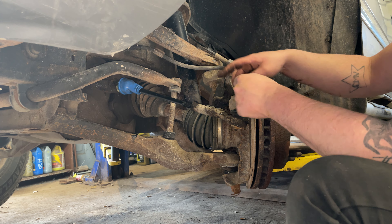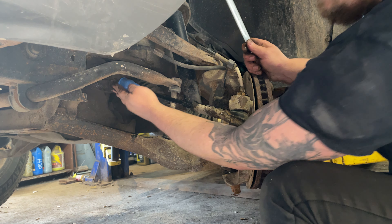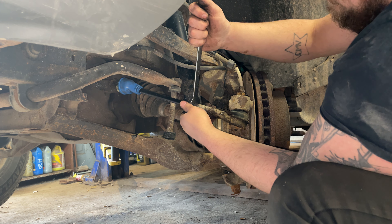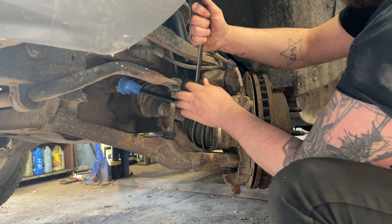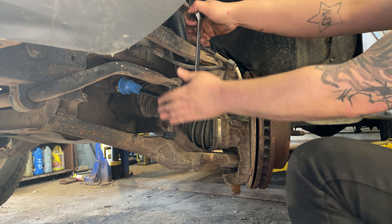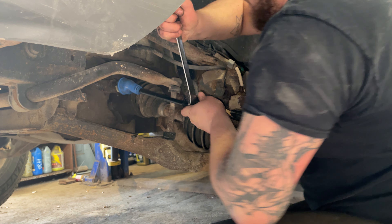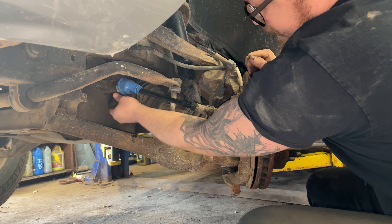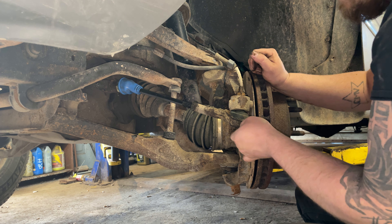This is tight. Now we've got to tighten up our retaining nut — that's going to be lefty-loosey to tighten this up because it's backing into the outer tie rod. We've got a grease gun here, we're going to grease our grease zerk right up in here. Give this outer tie rod another shot of grease just for good measure.